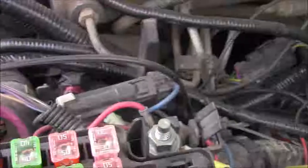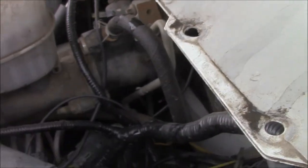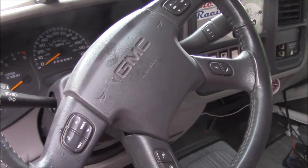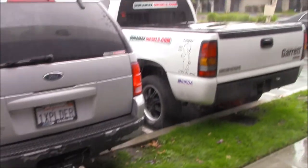Trace these wires outside the fuse box — right in here, in this little bulkhead of wires, you can already see them. You also need to make sure all the electronics function: this 15-amp fuse and this relay need to function. Your trigger circuit is already here in the cab. As long as your horn circuit functions, your nitrous will function too. We're going to allow the horns to still function when you're done.